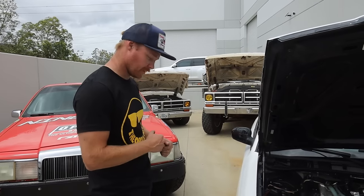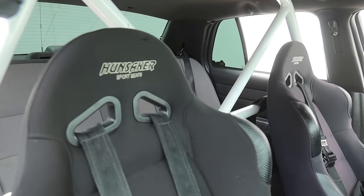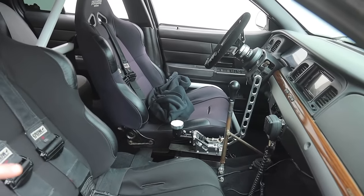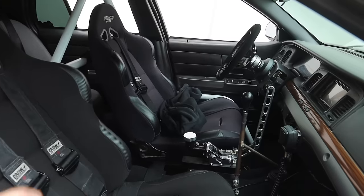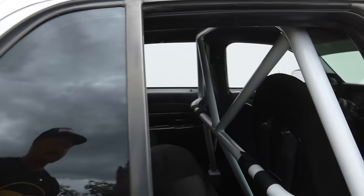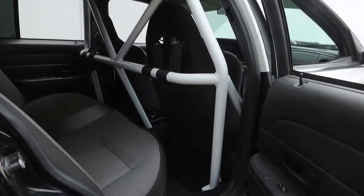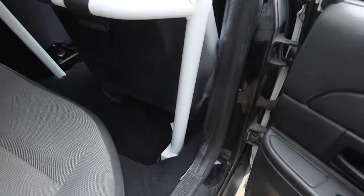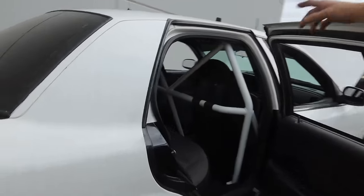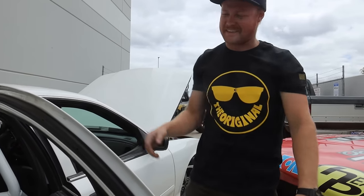It sounds cool, looks cool — everything a Crown Vic owner would want: a manual with a hydraulic clutch and a roll cage. Franklin and I built the roll cage in a couple of days from mild steel inch-and-three-quarter and inch-and-a-half down bars. We made 3/16 base plates on the floor, fully welded. It fits so tight you could put a piece of paper between the headliner and the top of the cage. It's an ex-cop car — you can see the oreo colors on the inside of the doors. The siren box still works. We also built a chassis-mounted shifter with about two inches of throw so it pops into gear really fast.